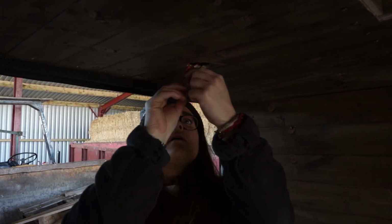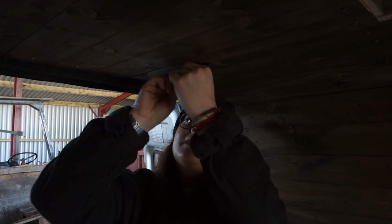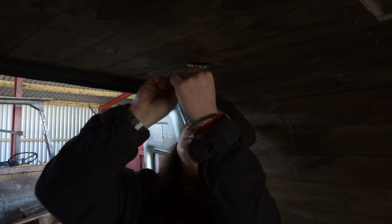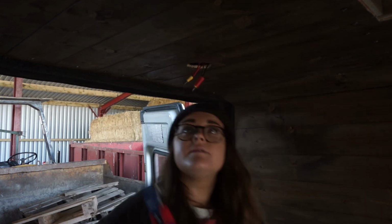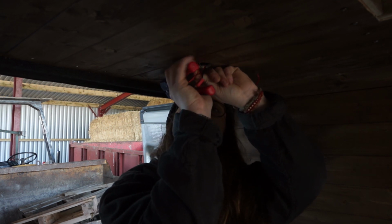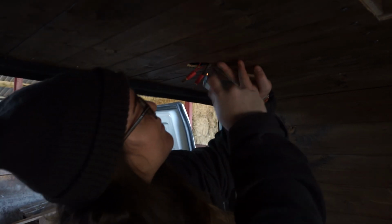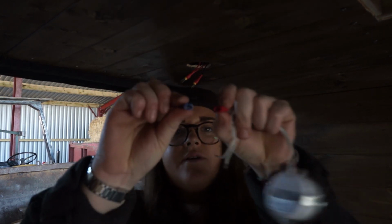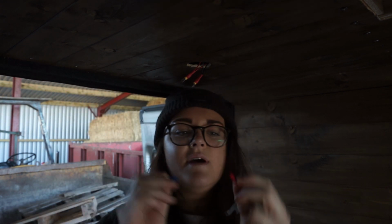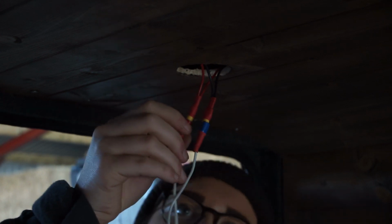So that's popped on. I'm going to put the heat shrink over it and then I'll deal with that in a sec. I'm going to do the same again with our 2 positives. Twist them together, put the blade terminal in the end. Then you can either use a hairdryer or a lighter. I hope this stain isn't flammable. Then I've got my light, okay? So I've got 2 of these. I have no idea if you saw that. Now to see if it actually works.